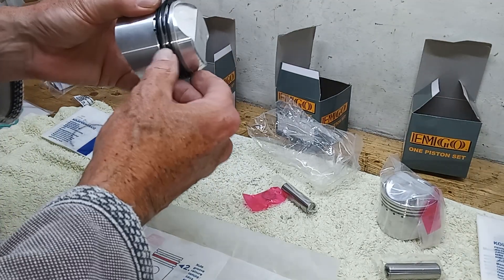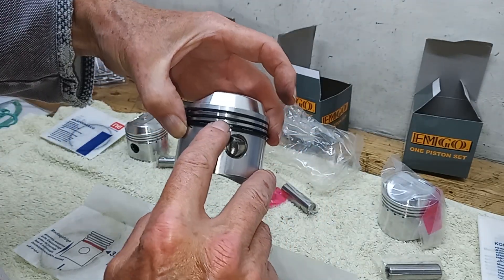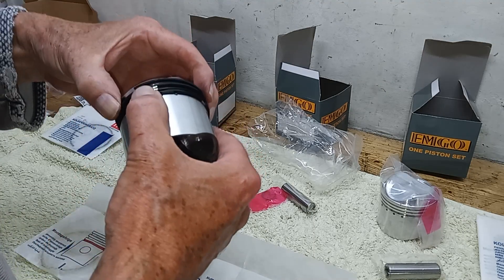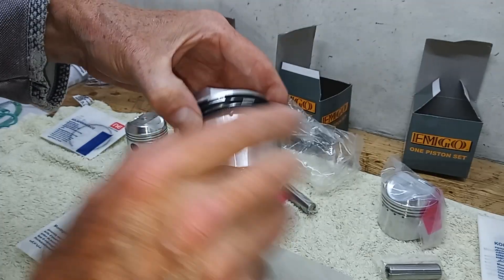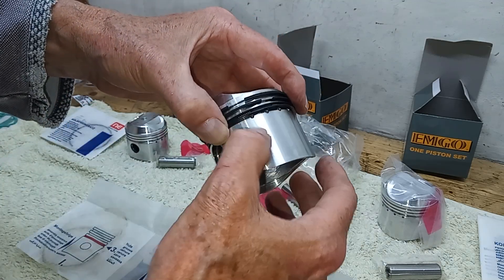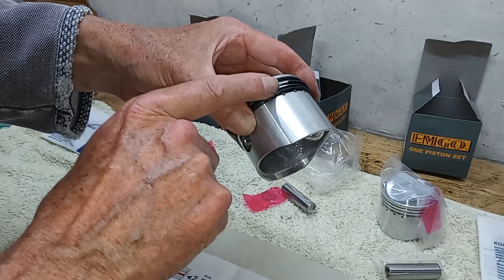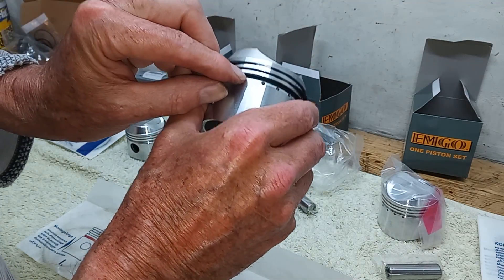I like these rings because the oil control ring is two-part with a spring in the middle. Sometimes they're three-part rings with a little bottom ring, then a spring, then a top ring, and I hate them because they're so fiddly and it's much harder to fit the pistons. When you put the piston ring clamp on a three-part ring, you have to have the clamp right down over the bottom of the ring otherwise the bottom bit will come out. With these you can only just clamp them anyway given the room available.